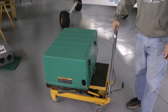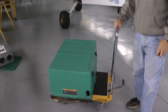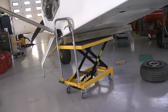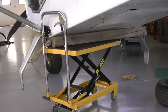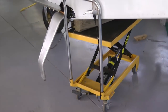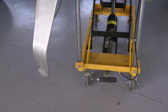This jack has some wonderful applications when it comes to working on our aircraft. It has always been a challenge to find a safe way to support an aircraft when trying to work on the landing gear, wheels, or brakes. With this mobile cart, together with a piece of lumber, it is simple to properly support the fuselage body and quickly raise the aircraft off the floor. Prior to using this cart, it was always a challenge to find a reliable and safe means of doing this. The large surface area of the cart means the stress is spread out over a large area of the structure.